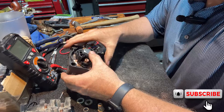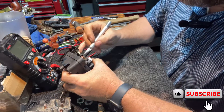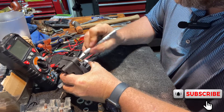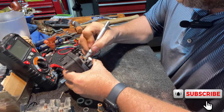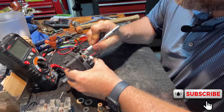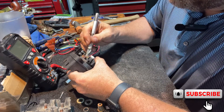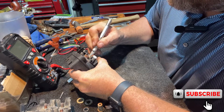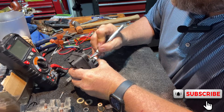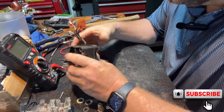I started looking at the forward and reverse switch. This switch got hot several months ago — you can see right here it did a little damage. It got hot because there was a loose connection in the back. I figured that out and fixed it, and we'd been using this cart and it had been working fine. Every now and then there was a little hesitation when you put it into gear — you'd press the accelerator pedal and it would pause slightly, then go.